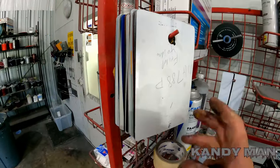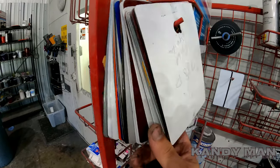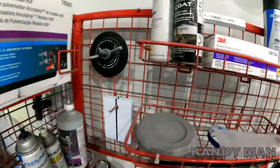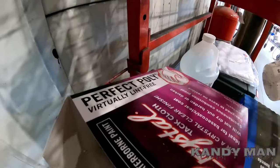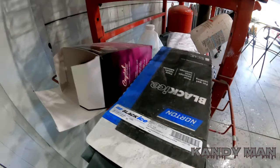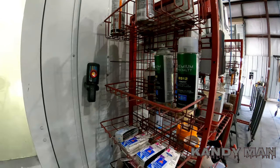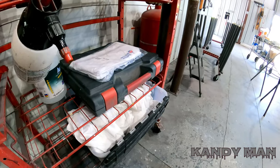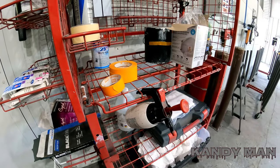I've got my spray-out cards — these are all my cards that I have sprayed out of colors that I know I have dialed in. I have my new ones over here so I have them ready. I'll keep different cans of spray paint and my tack rags on this side, plus the crystals. 1,000 grit in case I need to nib out something in the base. I keep my sunlight right here, so this is all close by the door. I've got access to everything — my rags when I'm cleaning down parts. I like keeping my stuff right in my area so I don't have to go far.